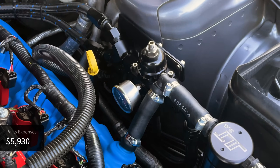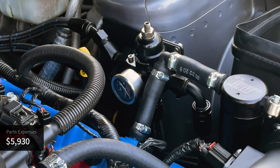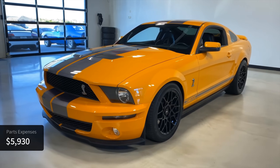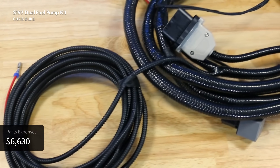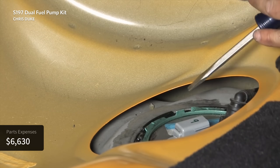Now let's talk about the fuel system. On my build I went with a custom return style setup that requires running larger fuel lines to and from the engine, different fuel rails, and installing a pressure regulator. Return style setups are a pain, and I'm not entirely convinced you even need one unless you're aiming for over a thousand wheel horsepower. Instead, I recommend the dual fuel pump system used on the 2007-09 Shelby GT500s. The kit is available for around $700, is a direct replacement, doesn't require running new fuel lines, and is overall way simpler to install, which will save you a lot of time and money. If you approach the limit of the GT500 dual fuel pumps, you can always add a booster pump or upgrade the fuel pumps.